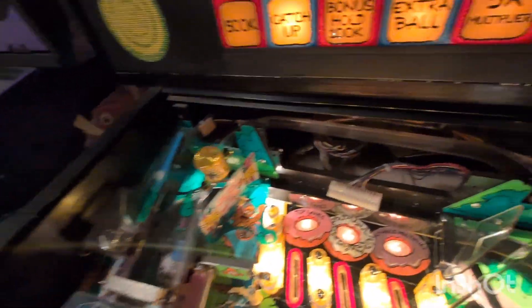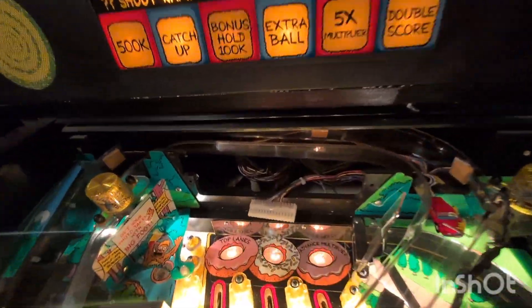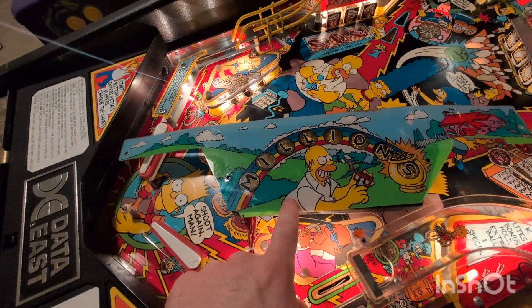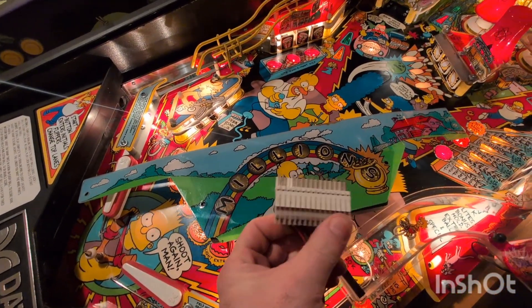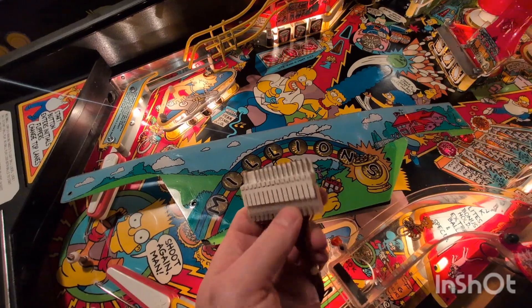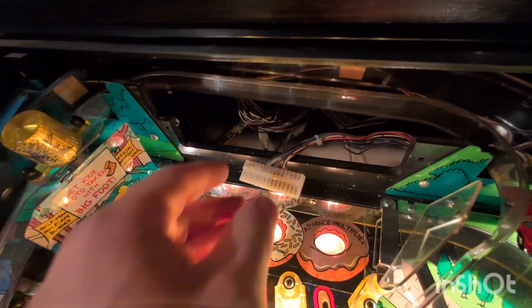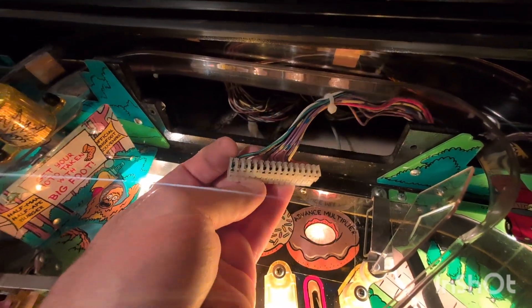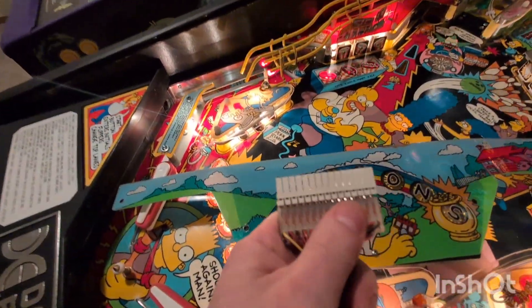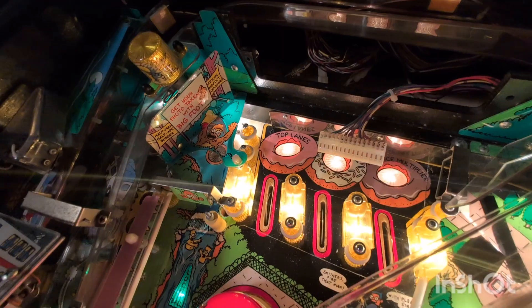This is one gigantic ramp, all in one piece. It goes behind the back panel and I've already removed my millions plastic. You can reach under the play field with it up. There's a Z-type connector — it's a female, then a double male, then a female connector you can undo. All of the ramp wires are also on a Z connector down there too. Just make sure they're probably different sizes of plugs so you don't get them mixed up. I just left the Z connector on one and took it off the other so I couldn't cross-connect them.